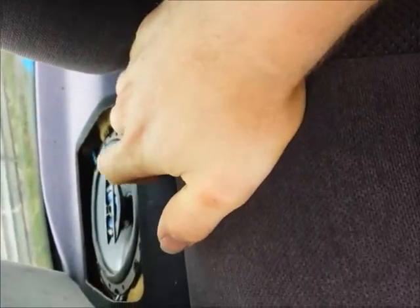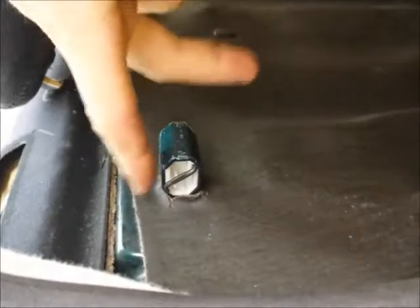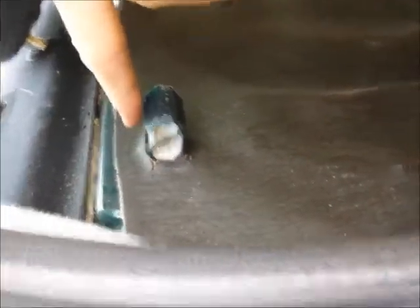Okay, I just remembered how to do it — it's been a little while since I've taken the seats out. What you do is just grab under the top here. There are no bolts at all at the bottom. What you do is grab between the parcel tray and the top of the back seat. Get your hand in there — it's kind of tight. Maybe use a soft pry tool if you can. Try not to damage the rear parcel tray. Get your hand in there and just give it a tug out — same basic kind of clips as on the seat pan.